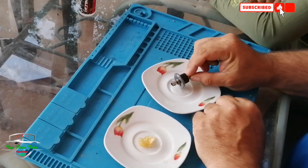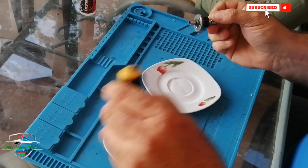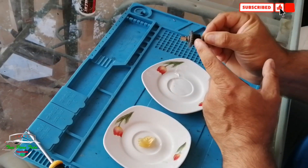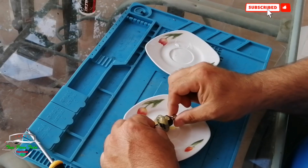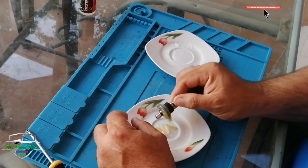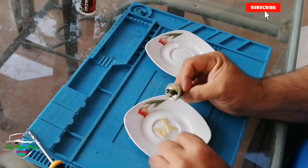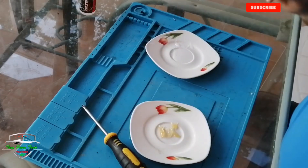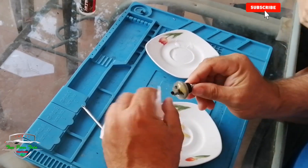This happens on the outside as well as the interior. Even if we have a small leak from somewhere inside, the oil level in the cup ensures the gears below always move through oil. What happens with grease? When it heats up and the differential spins, centrifugal force pushes the grease outward to the walls and to the outer rim — and it stays at that outer point rather than falling back.